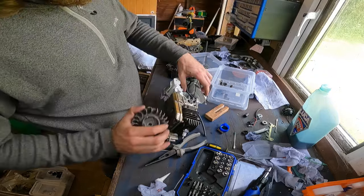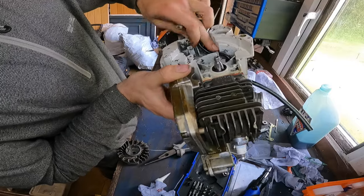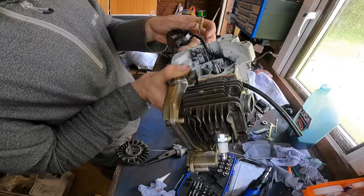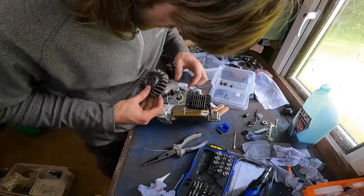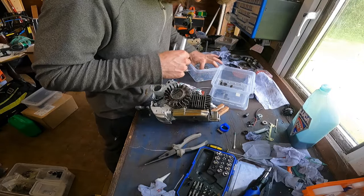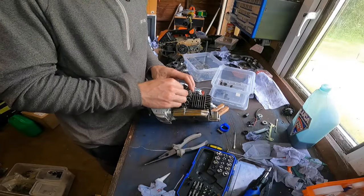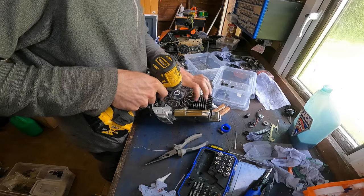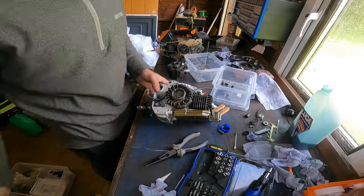But first, you need to make sure these wires go in this little thing there. Yeah, usually big one on top, little one underneath. Like so. Then we can put our flywheel on where the key is. There we go. And we'll get our little nut that goes on. This one's clockwise. I use an impact. Hold it, let it. There we go. So all that needs.